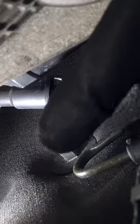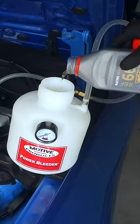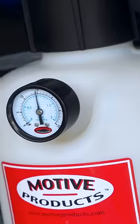Reinstall the line with the clutch line seal, then remove your clamp and reinstall the bracket. Bleed the system from the slave cylinder using a power bleeder and a small amount of brake fluid up to 15 psi, then button everything up before lowering your car.